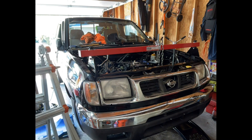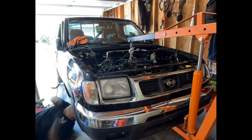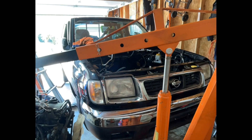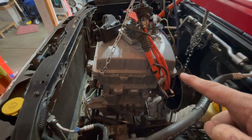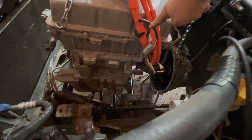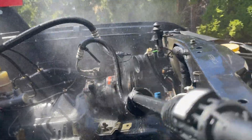Now that I knew the motor worked, it was time to bite the bullet and start working on the truck. First thing to do was load the battery into the bed of the truck — I'm eventually going to build a battery box either under the bed or near the cab, but doing it this way for now to keep the cost down. After pulling the engine, I did a quick test fit of the motor stack and saw that the PDU was going to interfere with the firewall, so I decided to separate it from the assembly. I'm also keeping the AC compressor on the side, planning to use a scooter motor to power it, though winter is coming up so I won't need that for now. With the engine out, I rolled the truck into the driveway and gave it a good pressure wash.